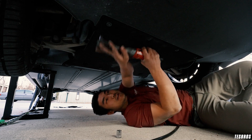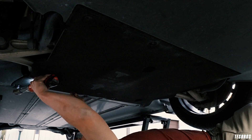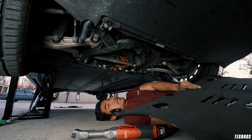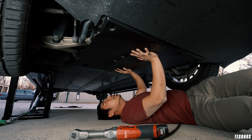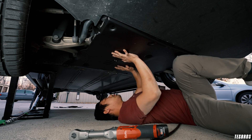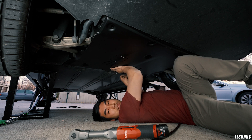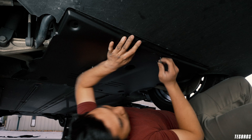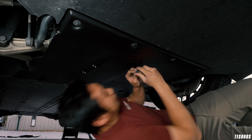We're going to remove all the 10mm bolts and then the 15mm. Just like the back one, the easiest way is to get it down on your belly and line it up the best you can, then use the existing bolts to start aligning. One thing about this product: it's aluminum, so if a section seems slightly off, once you put the bolt in everything slides into place the way it's supposed to. No worries — just put all the bolts in first.